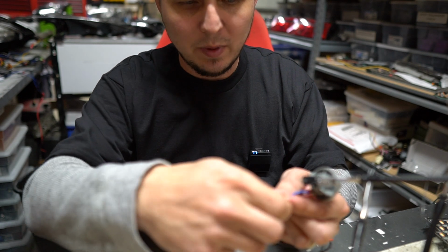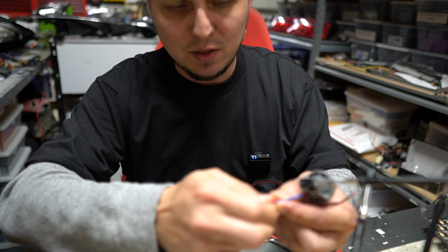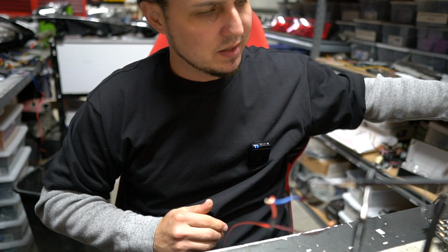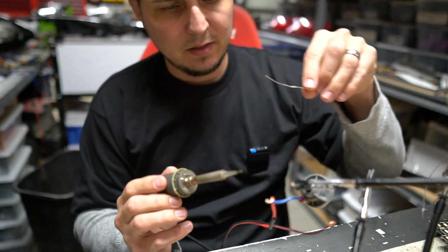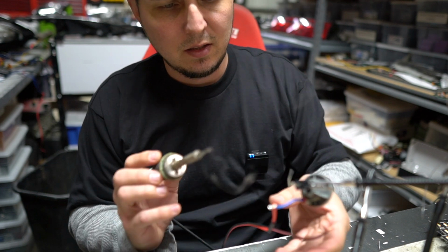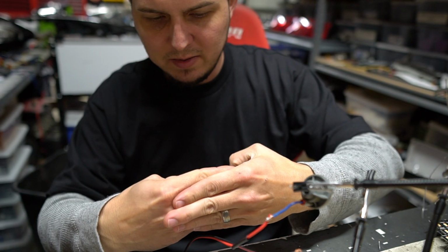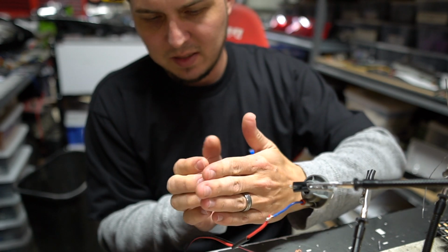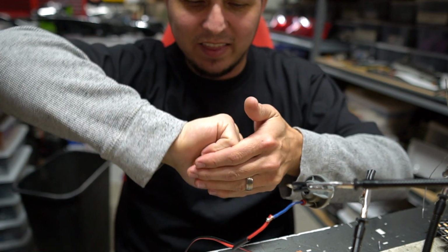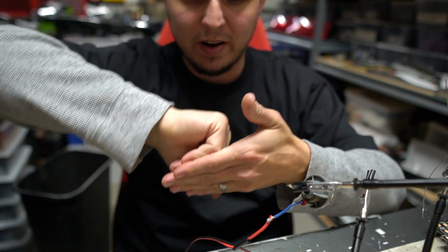This is a very common way to connect two wires. So you would twist the two ends together like that, so where they're both coming from the same direction, and then after you would solder on top of it, and after the solder is done, you basically bend that wire over. Now it's basically like, how do you do this with your hand? It's basically like that. And so you've got this weak point right here where the wire is bent.